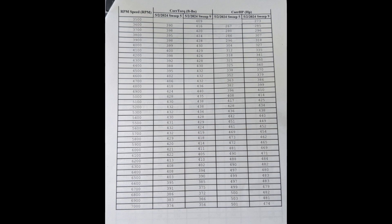I was expecting a little bit more in the way of power and torque numbers — maybe 460 or so peak torque. I'm not sure why it was less than expected, other than the correction factor, which you can see on screen was running at about eight or nine percent. I'm not sure if my machinist included a correction factor for inertia. Also, I was running a water pump — most professional engine builders you see dyno their engines on YouTube run electric pumps, so an electric pump would have been good for another five horsepower or so.